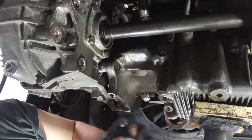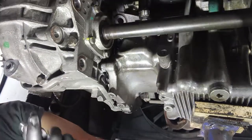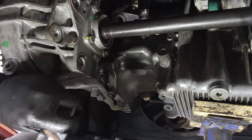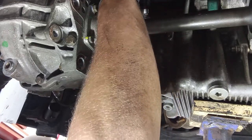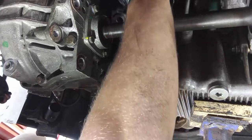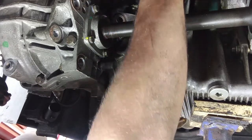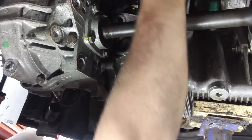Now the 13mm head bolt on the starter up there, I hope I can show you, but it's not very difficult at all. The two top ones are not there anymore. Well, one is not there, the other one was never there. I want to see if the threading of the gearbox is good or not, to accept the third bolt. I also hope to see the guide on the starter, because that middle one right there, where the bolt was missing, is the one that carries the guide. So I hope to see that.